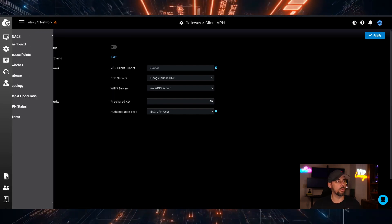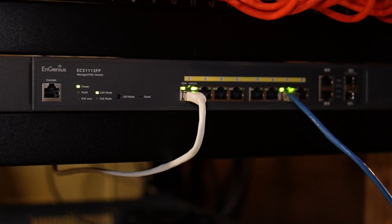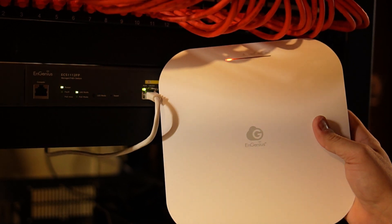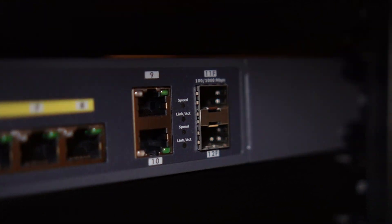We keep seeing a 'Pro' tag — what does that mean? There are two licensing tiers. TP-Link and Unifi don't typically go down the licensing path — that's an enterprise thing. Right out of the box these devices have a Basic plan: they'll function, pass Layer 2 traffic, and do the bare minimum. You can upgrade to a Pro plan at an additional cost per year or per port, on one-year or three-year terms, which is standard for enterprise-class hardware.